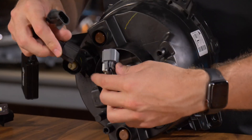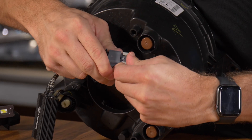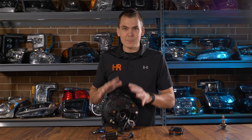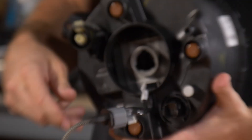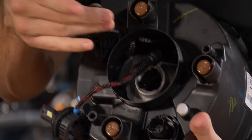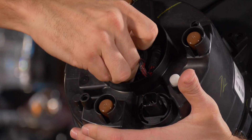The PWM module installs by plugging into your factory wiring. Press your locking tab back down — this end goes to your bulb. In this case I'm using the SV4 bulb as an example, and all of this does fit back into this headlight. There's a little cavity down below where the headlight bulb installs. What I like to do is install the PWM module first, then the driver for the LED bulb, and then finally the LED bulb itself.